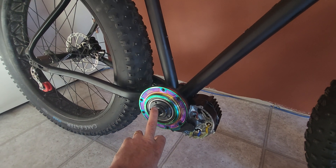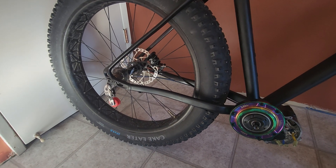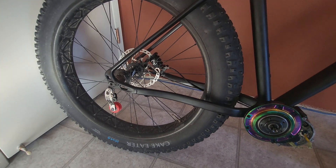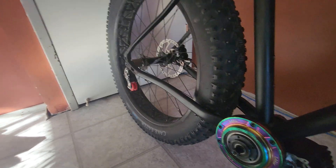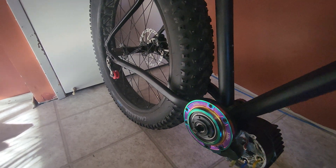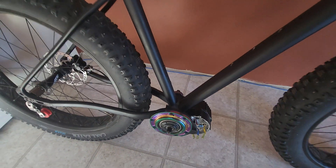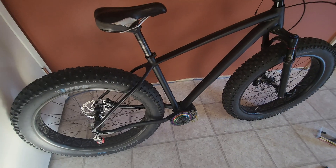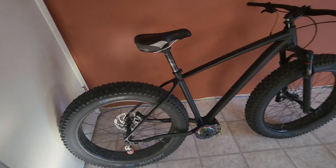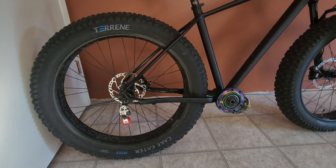So that's the BBSHD done for now. The next video on this bike will look at the chain line and how I'm going to get a nice single-speed setup at the back, using a 42T up front and maybe a 42T or 40T at the back — I'll try a 40T and see how that looks. That'll explain how to get a nice straight chain line back to the rear cassette, which is another thing with high-power BBSHDs that you want to get absolutely bang on. Anyway, thanks for watching — if you've got any questions on installing BBSHDs let me know in the comments, and you're welcome to join our Discord channel for lots of help building a really cool e-bike. Thanks for watching and a special thanks to all the channel members — cheers!